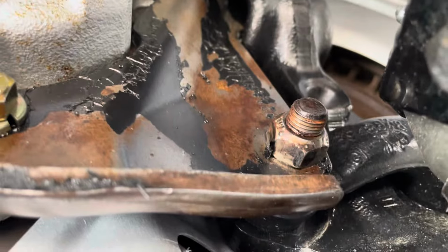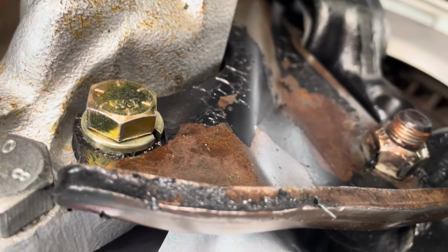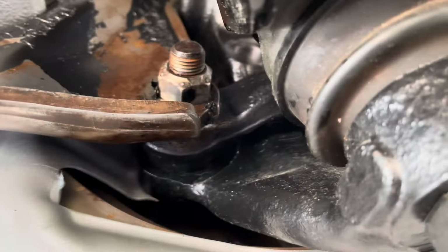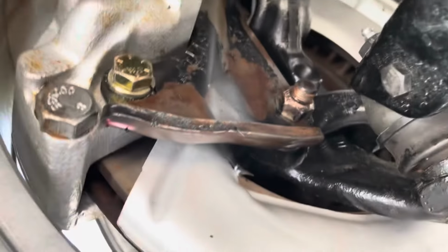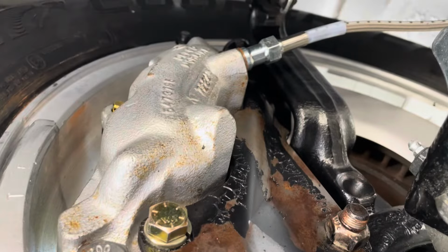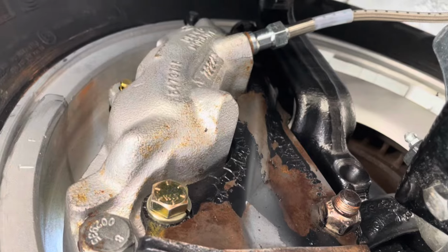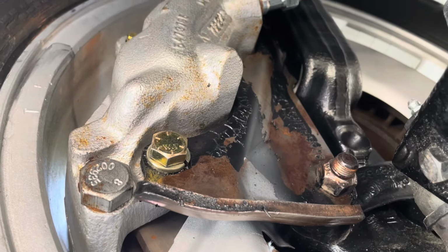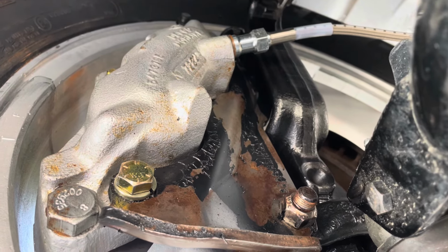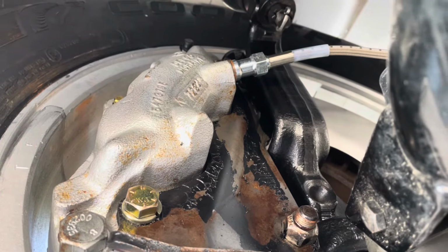I've been doing a gravity bleed. I checked the master cylinder. It's down about a quarter of the way. So it's not fast, but man, that is ugly. Hopefully I can diagnose this. I think I'll pull the caliper off, maybe wrap it with some paper towels and see if I can locate the seepage. I guess I'll see if the back of the brake pads have anything on them. Maybe the brake pads are ruined.